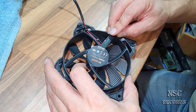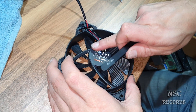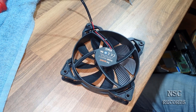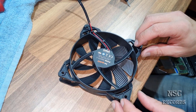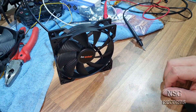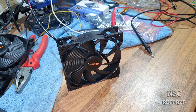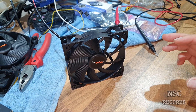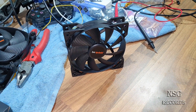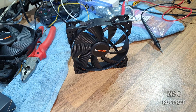I hope you guys liked this video. This was the most important stuff you should know about fans for power supplies - information that was missing from my other videos. Now you'll be able to replace your power supply fan. Do not go under 1500 RPM - that's the minimum. I recommend 1500 to 1800 RPM. If you have questions, leave a comment, thumbs up, and subscribe.